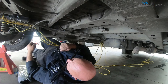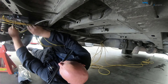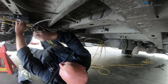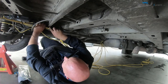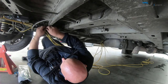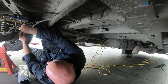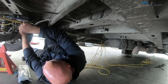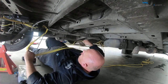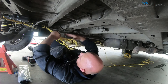The next step is to secure the cables to the chassis of the vehicle. Make sure that the cables are not running on or near any sharp objects and avoid any hot components such as the exhaust. Use cable protector at any positions where the cable may be exposed to damage, and use cable ties to secure the cable against the chassis. Where possible, secure the cable to any existing cables in the vehicle but avoid brake and ABS cables. Secure all excess cable to the chassis so that it does not trail along the floor.